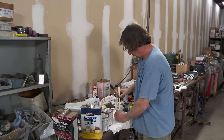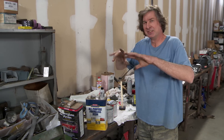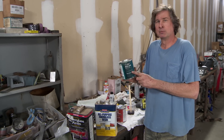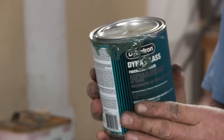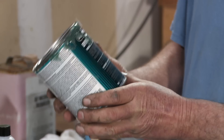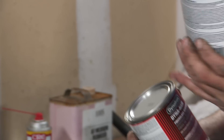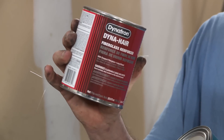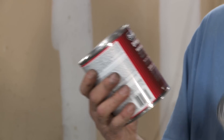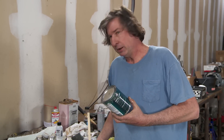We've all heard about different kinds of body fillers. These fillers are kind of a little different, because they're very similar to standard body filler you'd use to fix a dent, but they're reinforced with fiberglass. Generally, you'll find this in long strand and short strand. The long strand stuff is really furry, so when you drag it around on your workpiece it's not easy to form, and it's a nightmare to sand — but it's strong.